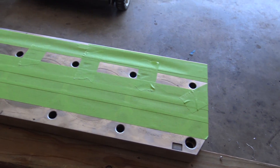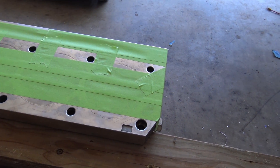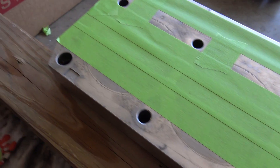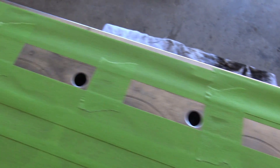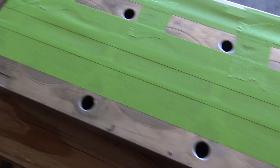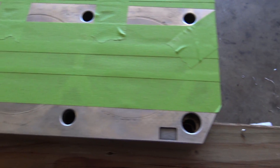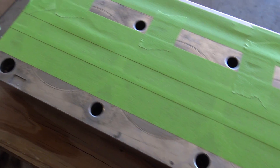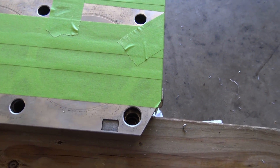Just take your time with it and go straight. Like I said, it's 90% drilled out already. If you want to save a little money on the machine shop, that's all you really need done on these heads. Try tackling it yourself, but it's your risk. I'm pretty confident drilling these heads and the first head came up pretty damn good.